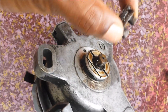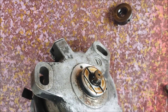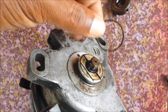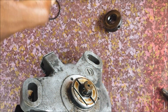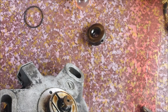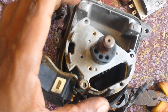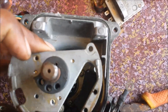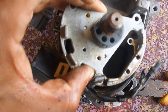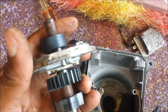We will remove this entire gear drive. So we have the gear out of the way — careful, it has some shims on the back. To remove it you just remove this retaining clip and this dowel should just drop out. Final step is the gear drive. With everything unbolted, just give it a little tap at the bottom and the gear drive should come out like this.